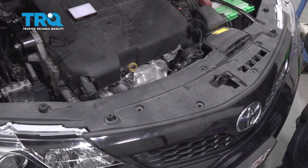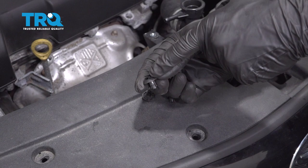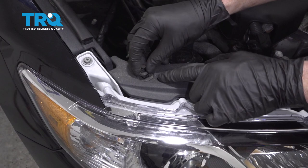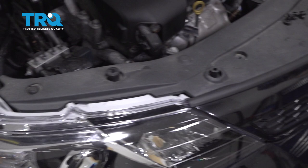Let's get this back on here, slide it into position. Line up all of your push clip holes and then start putting in your push clips. To insert the push clips, make sure they're in the unlocked position — essentially the center is pushed up. If it's not, reach in from the bottom and press up on the tab until it's unlocked. After that, you can continue on by installing them. Line it up with the hole, push down the outer portion, then lock it in with the center. Do the same to them all.